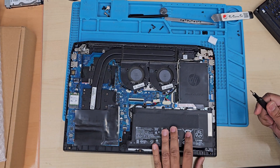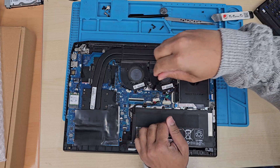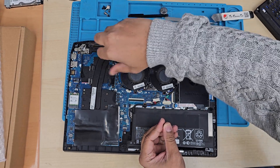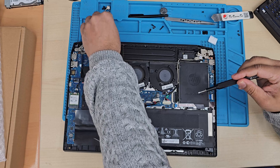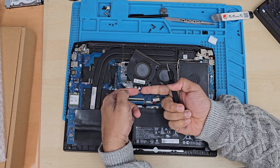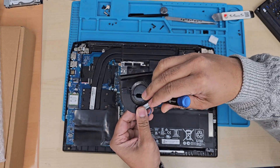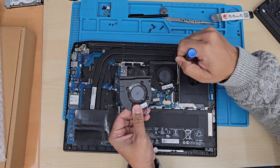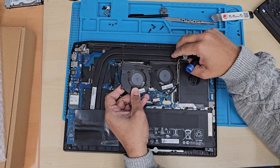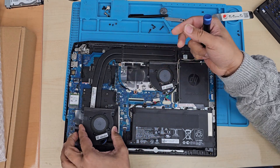To do this, take out the battery connector and then remove all the screws from the fans. There is no way to make a mistake — both fans look similar, but because of their shape and alignment you can't switch them over. Then take out the heat sink. Don't forget, under the heat sink there are many thermal pads — you can reuse them, just don't lose or misplace them. If you'd like to change the thermal pads, you can, which would extend the lifespan of the heating system. At the end, we'll check if the problem is resolved. If it isn't, then definitely the problem is the actual heat sensor or the IC.